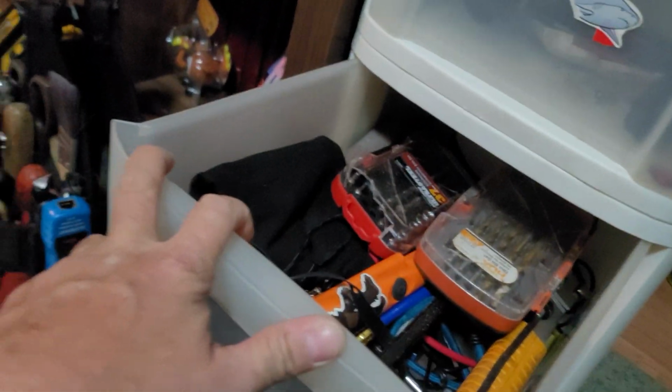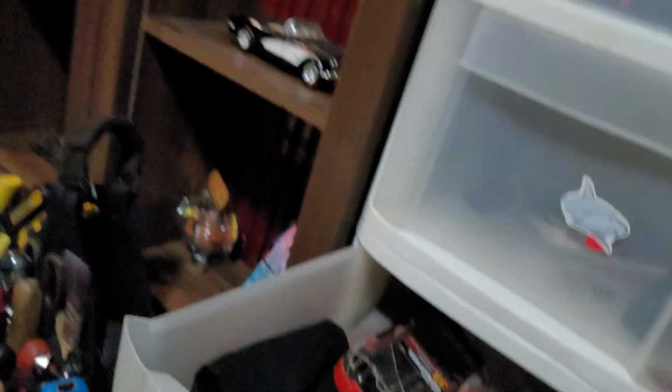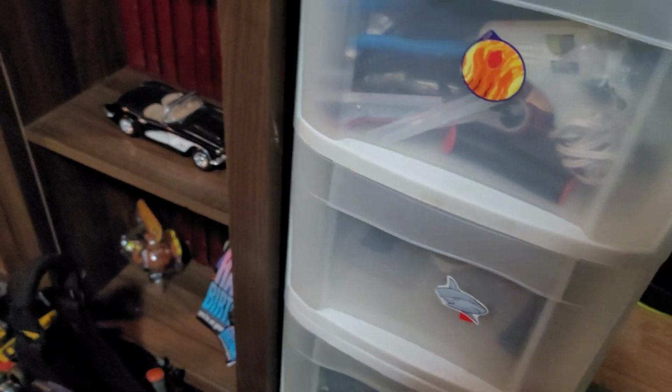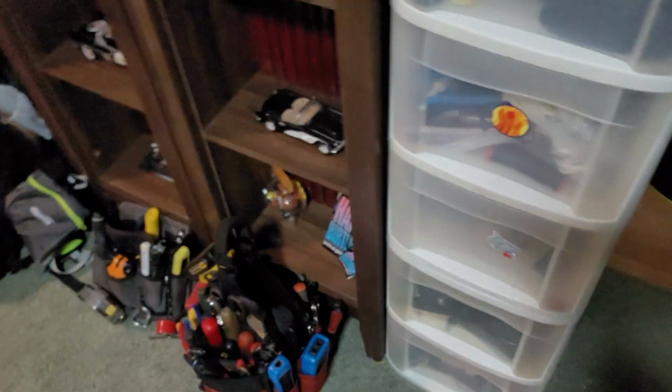If you're running an aftermarket speed bike and you don't want any current limiting factors on there, BMSs shut bikes down at 50 amps, 100 amps, whatever it's set for. So a lot of guys don't like to use BMSs. They want it wide open. They're running 400 amp controllers and all that. You don't want a BMS.